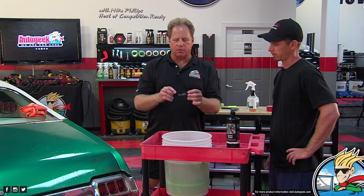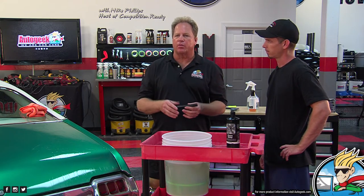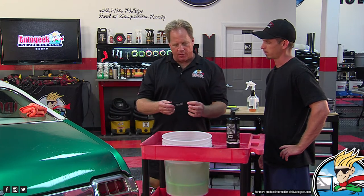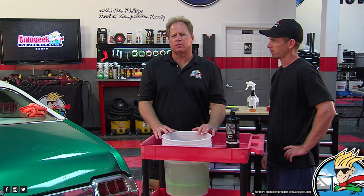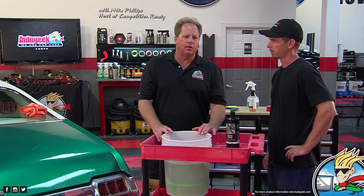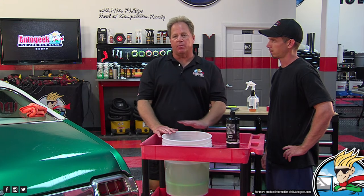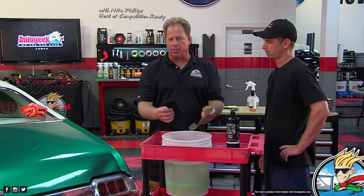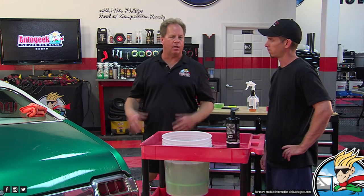So you can cut these however you want to. But what I like about these Meguiar's backing pads is, first of all, they're simple. They're just a simple semi-firm rubber with flat surfaces, because the goal is to keep that sandpaper flat so you're just knocking down the tops of the imperfections. And since they're rubber, a sharp pair of scissors will cut these. We do carry the red sticks. Those are more for specializing. If you're really going to get into, you're going to go work for Chip Foose and wet sand, hand block out his cars, those would be good for you. If you just want to keep it simple, the thing about this is, these finishing papers fit these backing plates. And of course, you can cut and make your own. They're relatively inexpensive. And I'm trying to keep this process really uncomplicated, not complicated and expensive.